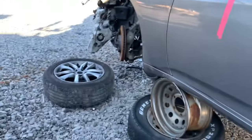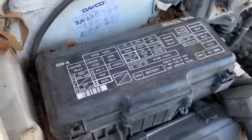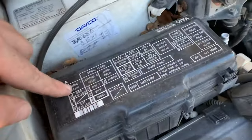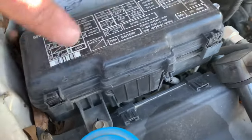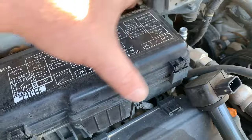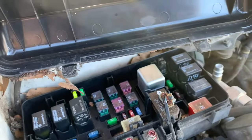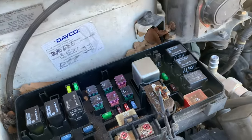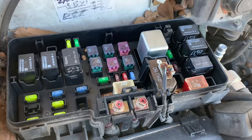There's also another fuse box under the hood on the passenger side. There'll be a cover here — the top side of the cover has the fuse positions labeled. You'll need to push in on this tab and this one as you pick up. There'll be a couple clips on the back side that hold it in. Underneath that cover you'll see the fuses and relays.